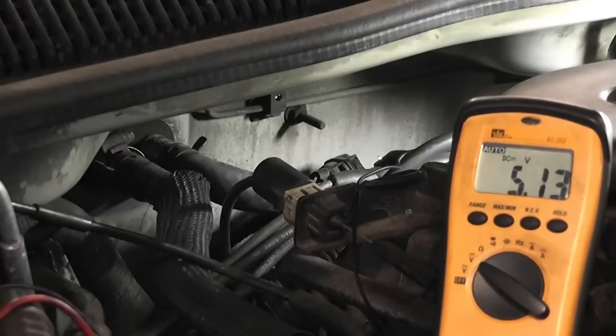When you check the feed voltage on a hall effect, the first thing you want to remember is that it should be steady five volts all the time, as you can see in this picture. This is not good enough of a test. You always want to do loaded circuit tests and make sure you're not dropping this five volts out on a crank. There's nothing wrong with this vehicle — I've disabled the ASD relay so the car doesn't start. Typically, when you're checking a crank sensor, you're doing it in a cranking condition for a no start.